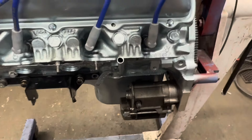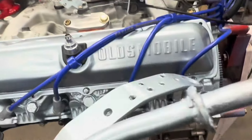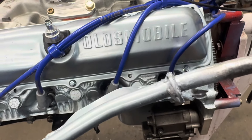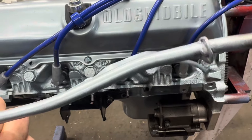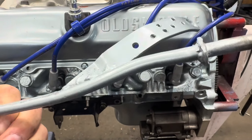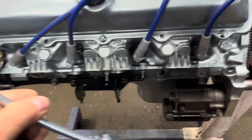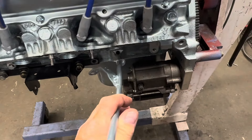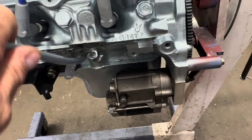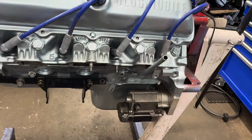This one was really fun the other day because I had spent a couple hours making it fit, welding a bracket on, getting it to clear the header. Then I took it home to paint it and it was cracked — right where the washer meets the tube. It was a tiny crack. You could RTV it and it's probably not gonna leak anyway, but a cracked tube isn't gonna last that long before it snaps off. So I tack welded it back together, filed it, welded it, filed it again — I have more time on this thing than it probably deserves. But it's ready to go, painted and ready to slide in. So that's the story — you can make your own tube out of 3/8 steel line, or 5/16 if you want, buy the reproduction tube, or try the LS tube. Lots of options. Hope that helped — enjoy the day, see you later.